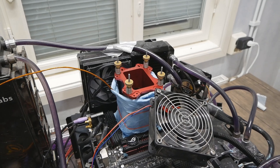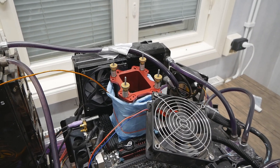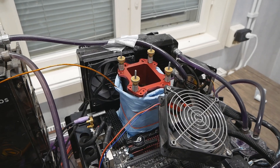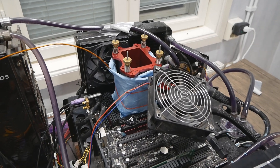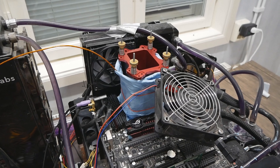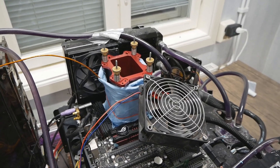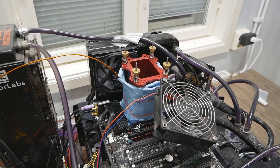The frequency level is quite low — for WPrime 32 the top score is made at around 4.95 on cascade cooling. For 1024M I would assume the frequency range is somewhere around 4.8 or 4.9. The single-threaded stuff is at 5 GHz and higher, so it's not super easy, but it's definitely easier than many other Bloomfield CPUs like the Core i7-950, 920, 965, and 975. I have never run this CPU before, so this is the first time I'm ever trying it.